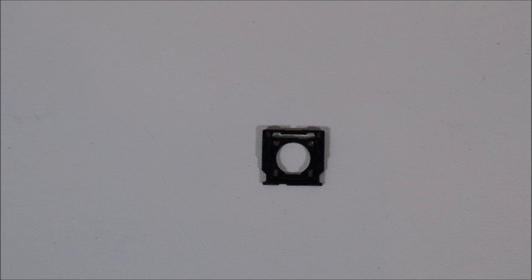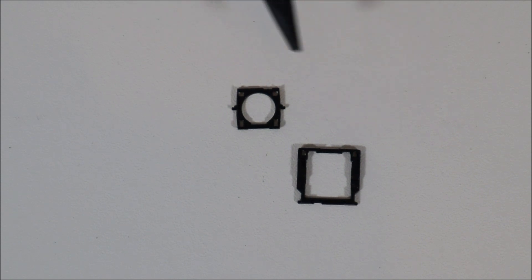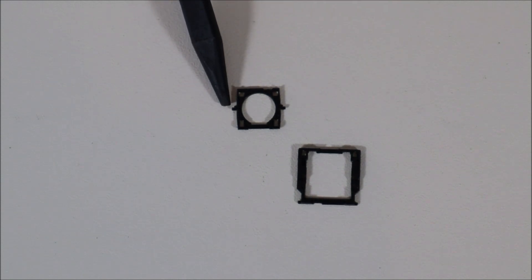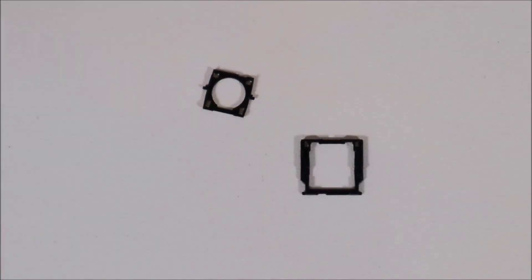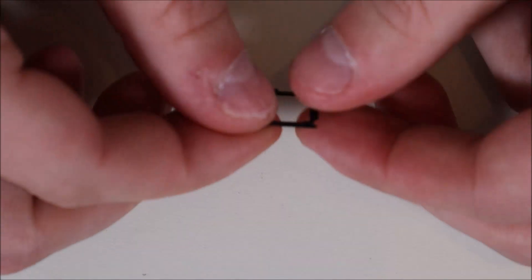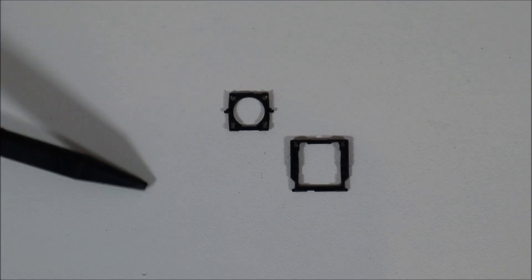The other thing is the hinge clip or the retainer clip in between your key cap and the rubber spring. That's a two-part clip. If it comes apart in two, you didn't necessarily break your key — that can be put back together. So there's your hinge clip or retainer clip. This is the inner clip, there's the outer clip. On either side of the inner clip you have these plastic pins and they go into corresponding plastic holes on either side. You can get this back in there. Hard part is making sure they're lined up correctly and that this isn't upside down. You may have to hold one end and gently pull out the other end to make room. Very breakable components, but you can put them back together.